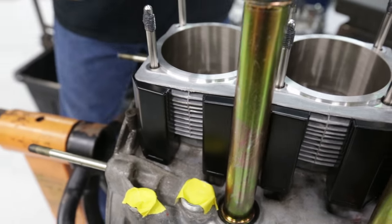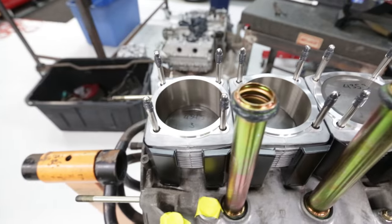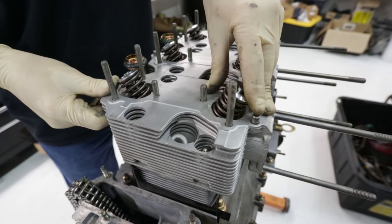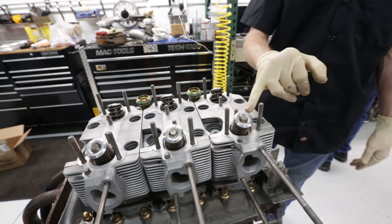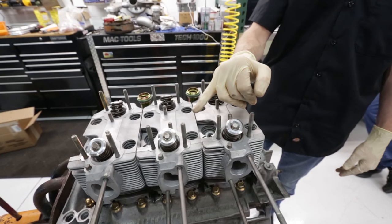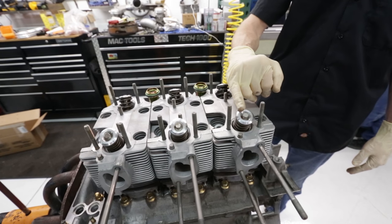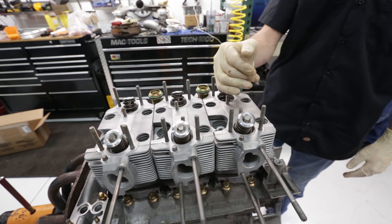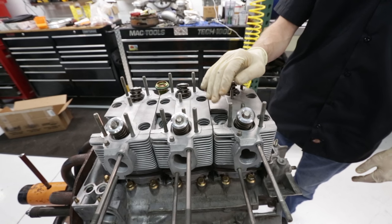With the cooling tins in place and the oiling tubes dropped in, out comes the cylinder head portion of the assembly. The cylinder heads have all new intake and exhaust valves. On the turbos, all the exhaust valves are sodium-filled. They're all 49mm intake, 41.5mm exhaust with 9mm stems. These have high-strength, high-RPM valve springs, so if you miss a shift you won't just bend the valves like you would with factory springs. Ultralight retainers help reduce reciprocating mass at higher RPMs for a well-balanced, smooth motor at high revs. They're glass beaded and super clean, with new guides and new stem seals — good for years to come.